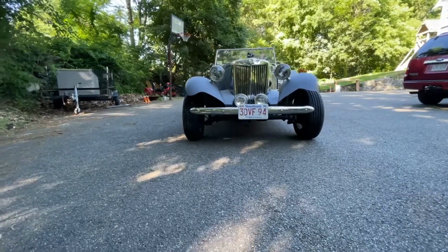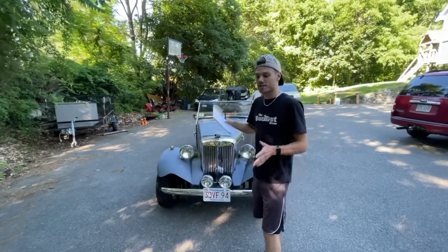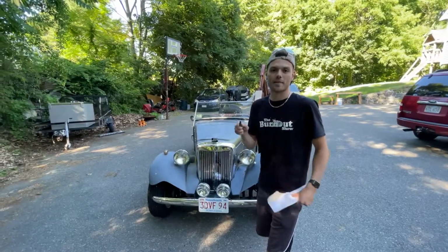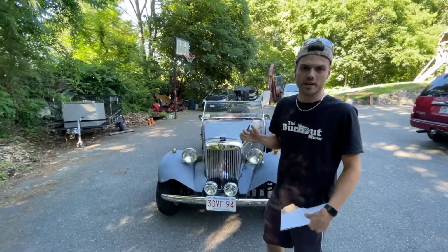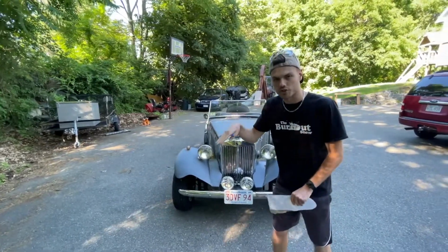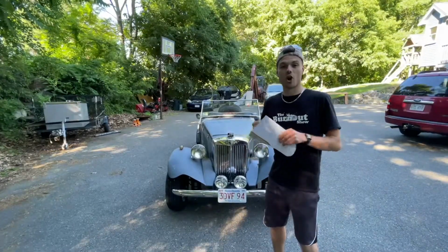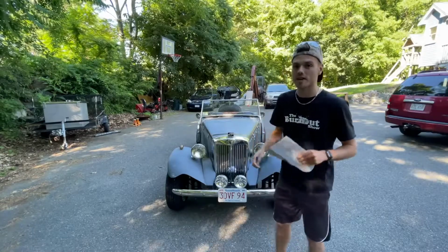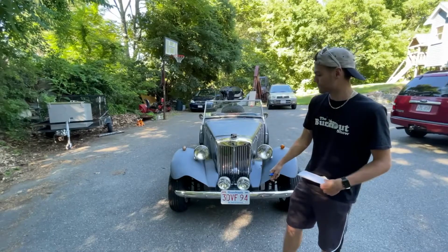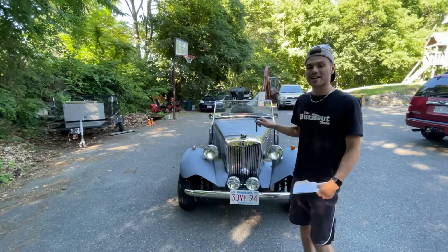And so when I hit a groove in the pavement or hit a bump on the highway, and then I keep going, my car steers hard left or hard right, and it's undeterminable every single time until you hit the bump. And that's the same with braking. When you have a hard brake with someone in front of you, in a modern car, you'll just stop going straight. Where with this, when you brake, because of the alignment, you steer hard to the right or hard to the left, depending on which way you are turning and how the alignment actually is. So take a good look at that, because car guys or car girls will notice that that alignment is messed up.